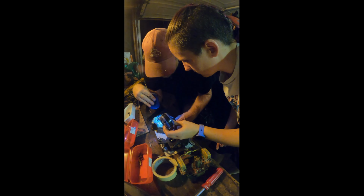Let this soak. See the buildup on each one's different. How dirty it is. This one's more. This one's clean. This is the side facing the motor. See how much dirtier it is? Something's wrong there. You can see the main jet hole down there now, if you look straight down the pipe. I saw the jet. It gives you the measurements on there, for all your tolerances. 1 3/16. Look at all that crap down there.